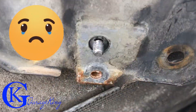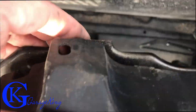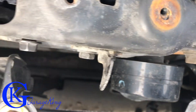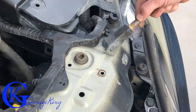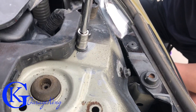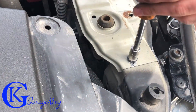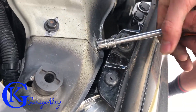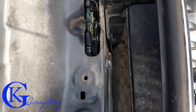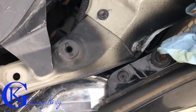Once we're done, let's find the bolts that go into the plastic and put the plastic piece back in. Just maneuver it back in the way you took it out — installation is reverse removal. Line it up, and once the plastic cover is installed, put a little anti-seize on top and also on the bolts. Note that these bolts have a flat flange — they're not like the ones that held the latch, so don't confuse them. What I do on all my jobs is I never tighten them right down — I snug them up a little bit, leave some play, center everything, and then go around and tighten everything up.